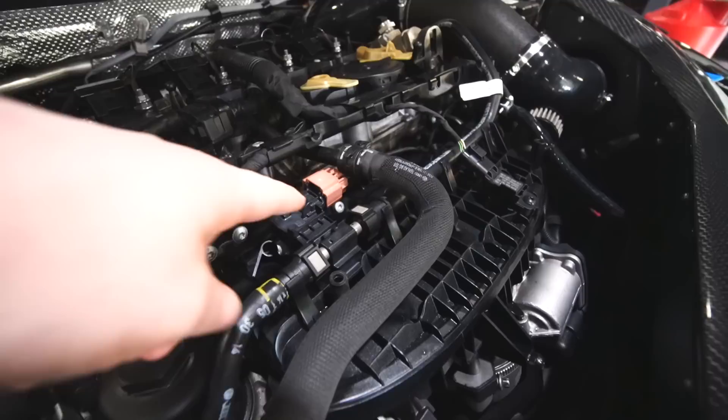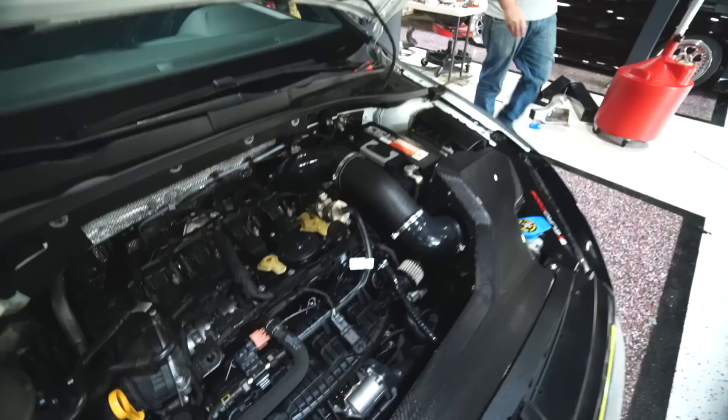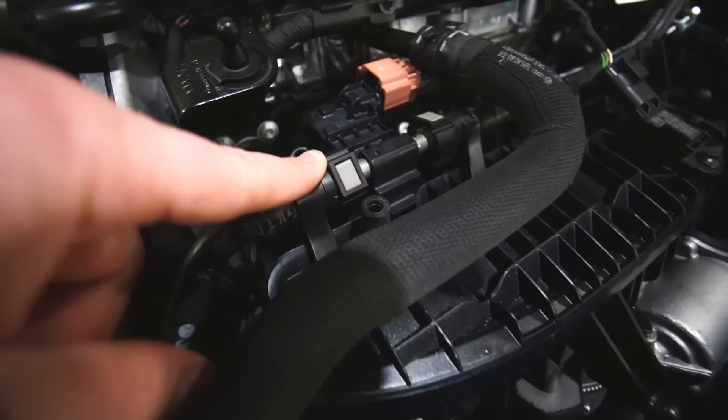The flex fuel sensor goes right here. So this is the sensor — that's what I just showed you in the bag. It came with obviously the sensor, this long wire, and these are the factory OE hoses. You just splice into those and put on the push-lock style fittings. They included the fittings, and then you've got this.